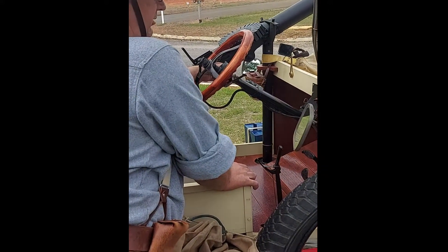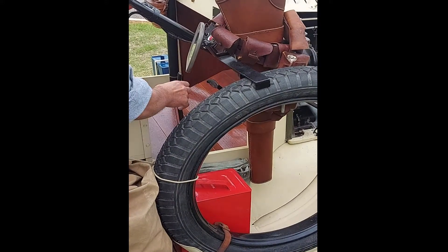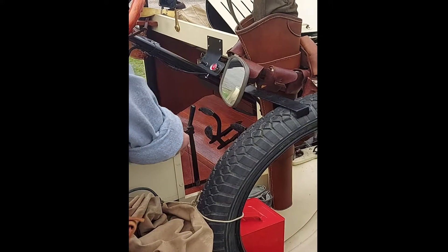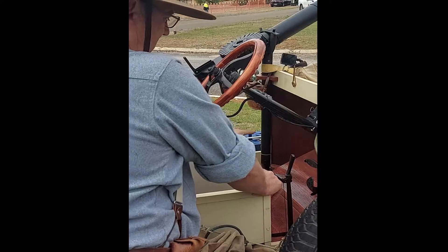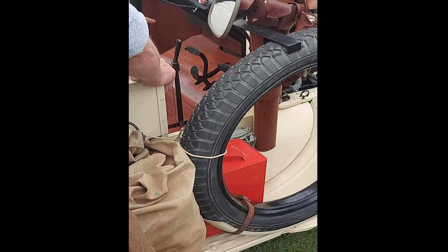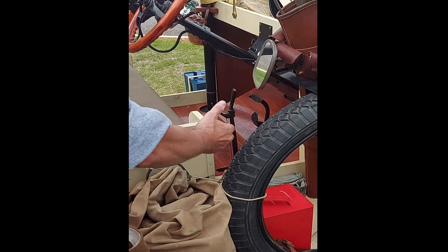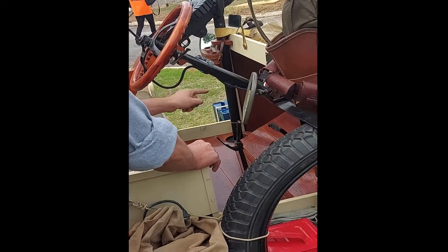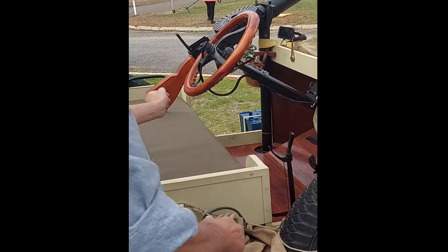All you do is open your throttle up. You're feeding the car more for speed. You're taking the handbrake to there, you're going to start it up. The handbrake's straight up and down — that's in neutral position. You want to get going, so you accelerate with that and push that pedal on the left hand side to the floor. That's your first gear. As soon as you take your foot off that, straight up and down it's in neutral. You want to get going in second gear, so you put that back up, stop the revs, take your foot off, push that all the way forward and rev up again — it's in second gear.